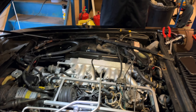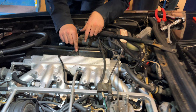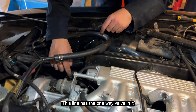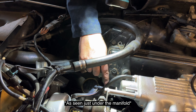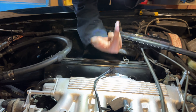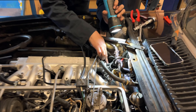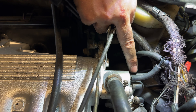Or should I say what I've done, just in case it doesn't work? This one here comes from the top of this manifold and it goes to a T, which carries on to the back of the distributor. This one runs underneath, comes over to the dump valve — I'll move that torch, Mark — comes to the dump valve here. It comes into the bottom of it, and then the line that goes into the top of the dump valve comes all the way along, comes up underneath — so the opposite side of this one. And then you simply plug off the one on the back here. This one here, which is closest to me, I've put a line in and then I've put a screw in the end just to cover it over.